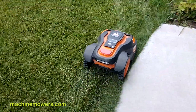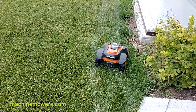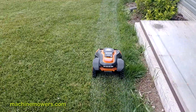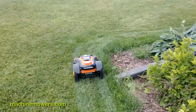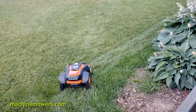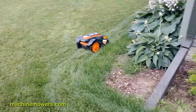When the robot actually runs out of battery, the blade will stop moving and it will return to the charging station much more quietly to save energy. The boundary wire is traveling roughly along the center of that wire path, and this is where the boundary wire is in your yard. Now, if that boundary wire gets cut, the light on the charging station will begin flashing, meaning one spot of hundreds of feet of wire has been cut. We have to come out and detect where the break is and splice it correctly. Don't splice it yourself incorrectly — just call us, that's what we're here for.